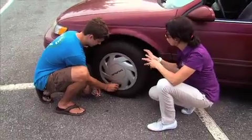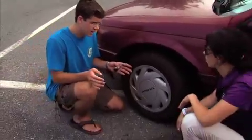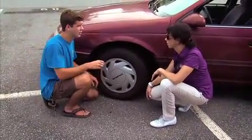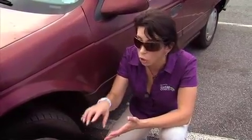Very good. Do you know what happens when tire pressure is low? If it's low enough, it can actually start making the tires flex more, and actually heat up, and it can actually explode. It affects your braking, your handling, your performance, and especially your wet traction.